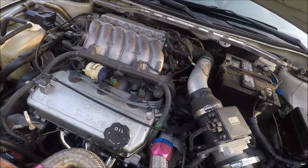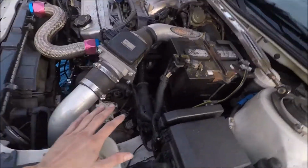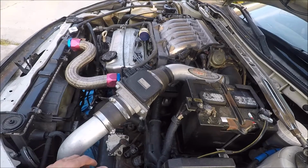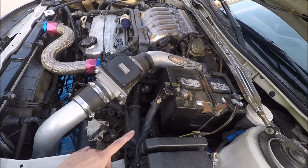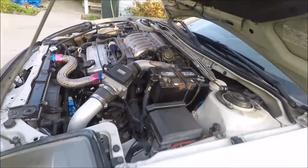Hopefully it improved my gas mileage a little bit, since all the exhaust has to come up then back down on both of them. I know my check engine light will be on, but it's on already for the transmission. When I got this car, it needed a transmission. I bought another donor car and put the transmission in it, but it was out of a 01 and it had different gearing. So I do have a 5-speed for this car. I'm waiting on the clutch and the motor mount, because it's got a different side trans mount, and then I will be pulling this back out to do that. I haven't really seen any videos on it, so if you're interested, I will be doing that very shortly, because this transmission does slip.